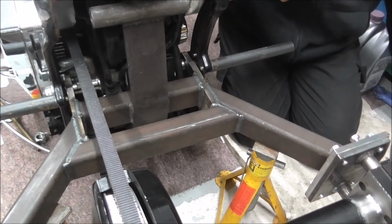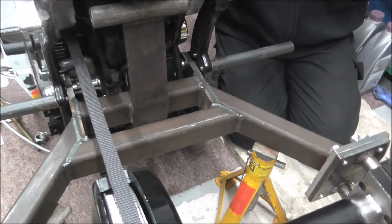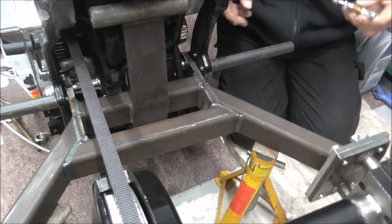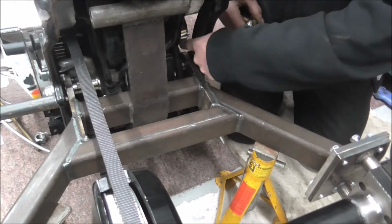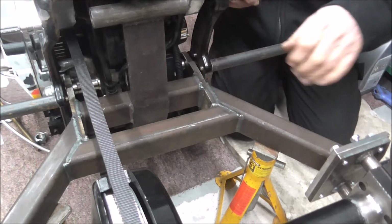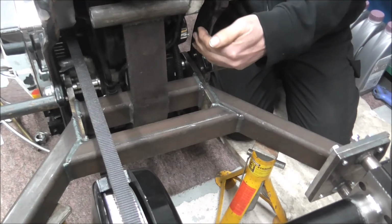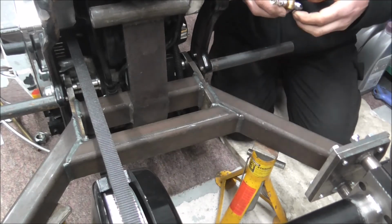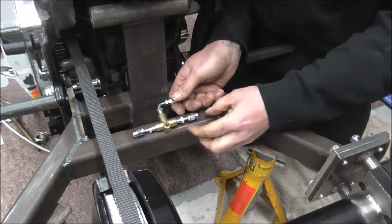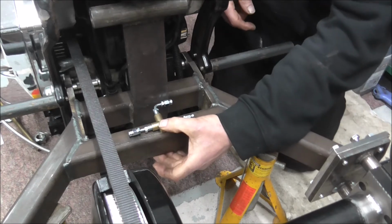and then I'll show you it on the top, but basically it's going to be underneath the swing arm. So I'll have a brake line coming up out of here and going back down, so it comes over the top of the pivot bolt. In that way, when the swing arm's moving up and down, the brake line can move with it without snagging on anything. But then on the underside of here, I'm going to centrally drill and tap the T-piece to fit underneath,